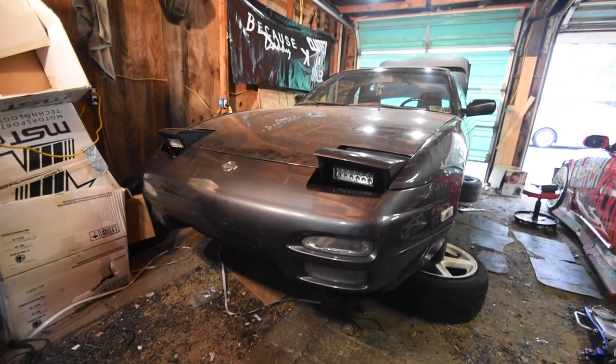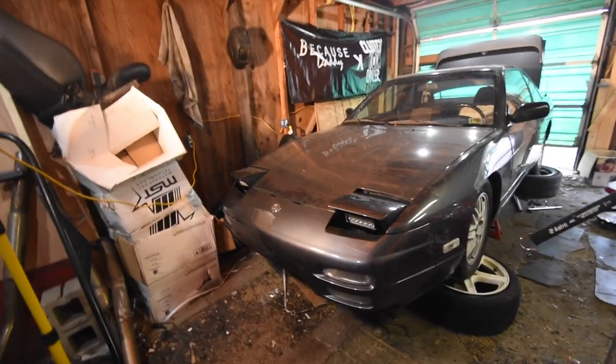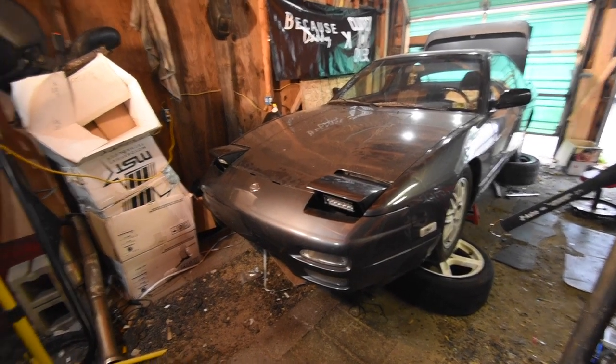I'm super happy with them — they came out pretty spectacular. Thanks again to Aux Beam for sending me these, they're awesome. Let me know what you guys think. If I skipped any steps, reach out via Instagram or the comments. To recap: run ground to chassis, use a small male connector, plug into the OEM bottom port — that's what sends the signal — then mount it up, snug everything, clean it up, and fasten everything down.